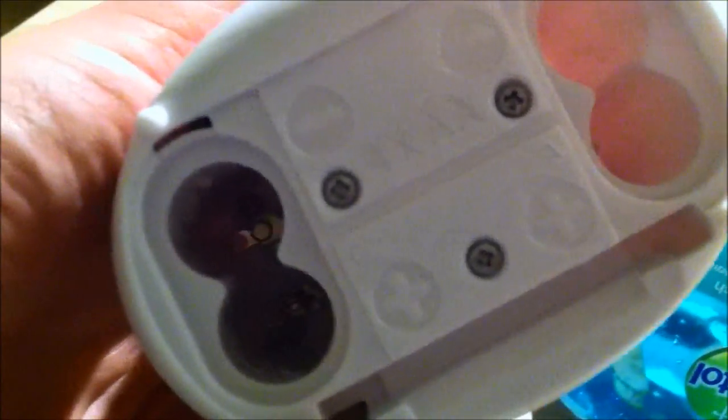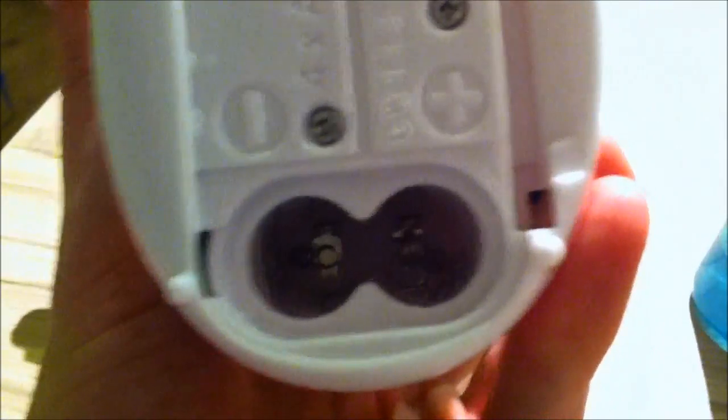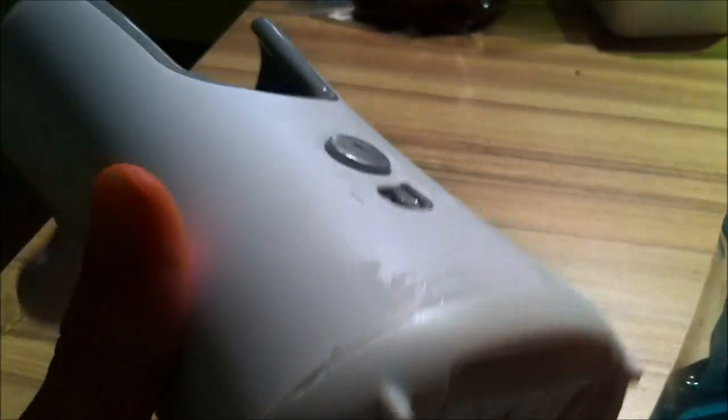Turn the unit over and look inside. You can see four screws at the bottom of the battery holes. Don't unscrew the three screws here because you'll unscrew the pump unit that's inside — you only need to unscrew these four screws right there. After that, take the gray cover off by pressing the eject button and grabbing the entire gray piece and yanking it. Very easy. Then unhook the proximity sensor.